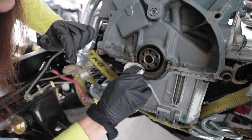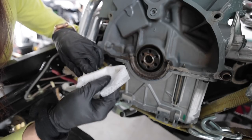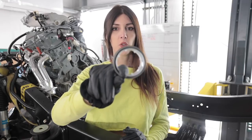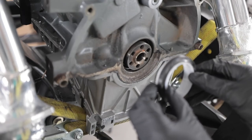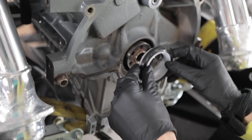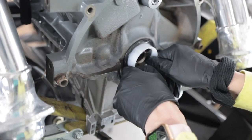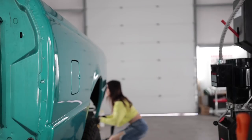Just in case there are any little bits of crud that fell inside this area when I drilled the hole, that's why I didn't push the drill bit all the way through — as soon as it broke through the other side, I stopped. This rear main seal is made out of PTFE, and this is one of the few things in life designed to be inserted dry. No lube. It comes with a little plastic ring that slips over the shaft to make insertion easier, and it slides over really easily.